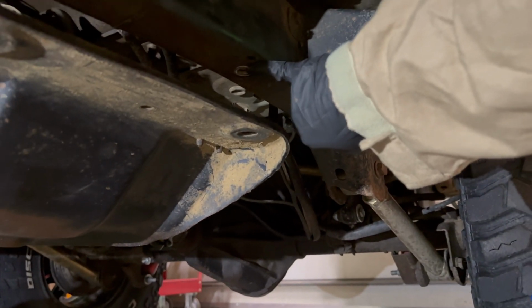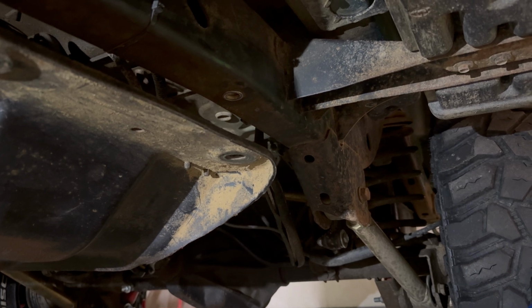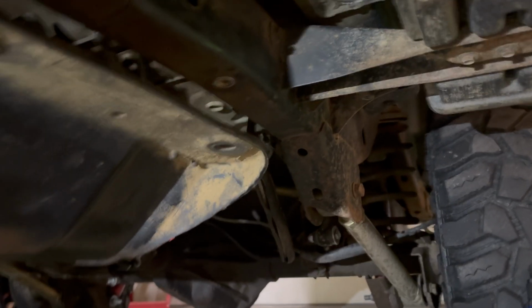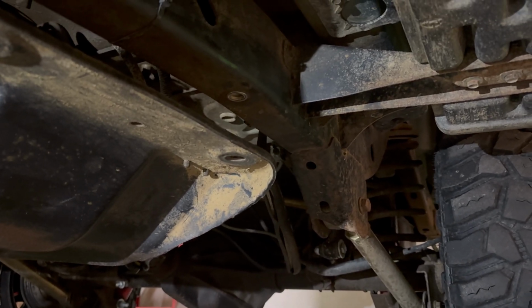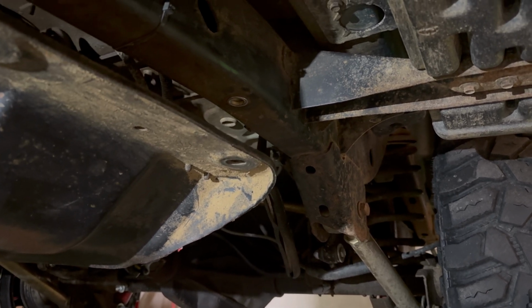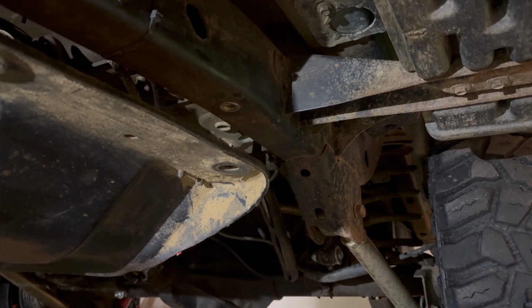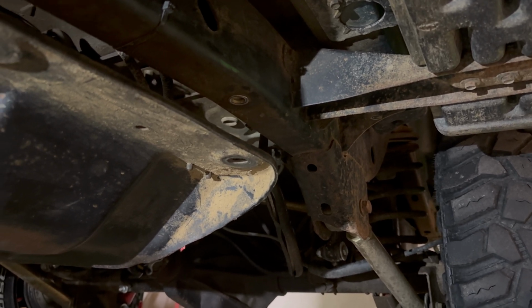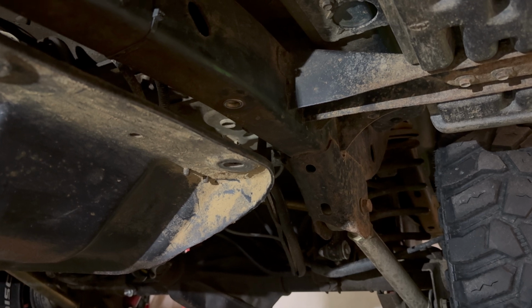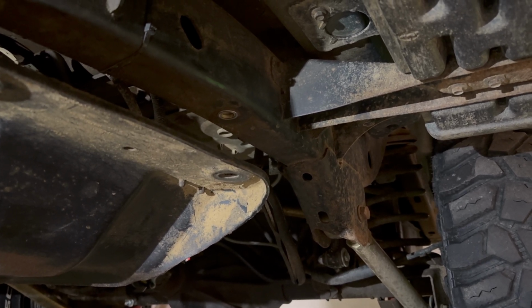And what I did is I put a bolt in there after I installed it, and then I made sure that it wouldn't free spin. At first, I tried just doing it by hand, and it was spinning in there, and then it almost got stuck in there free spinning. There wasn't enough friction to unscrew it. So I put some side load and then took my impact driver there and just zipped it out. And with the side load, it was enough friction on the RivNut that I was able to zip it out.